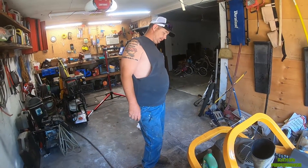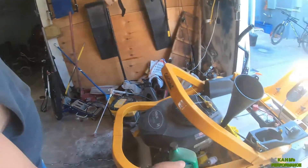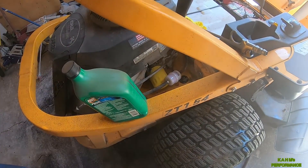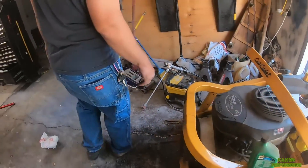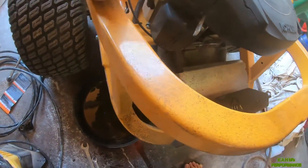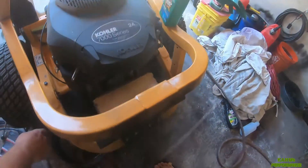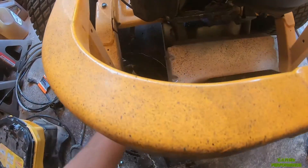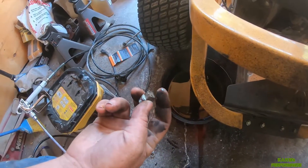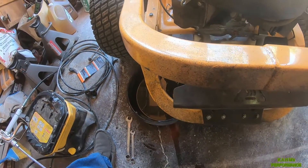Anyway, I just found a little trick. Your oil filter is right there — the yellow thing, the bright yellow thing. You've got a hose that comes out the side, right here, down underneath, and this hex head steel plug is at the end of it. This is a 13mm or a half inch. The hose is a three-quarter or a 19.